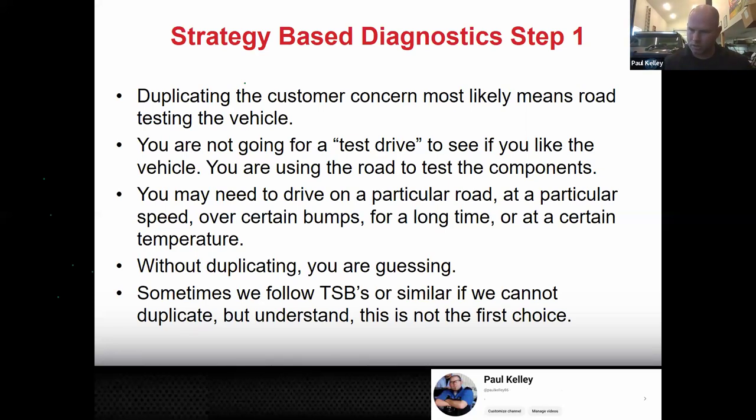On a Sunday, she'd go to Costco. It was full. She'd go down the aisle, no parking spots. She'd turn, go down this aisle, no parking spots, turn, go down this aisle. This car happened to have a loose wheel bearing. When she would turn, the rotor would flop like this because the wheel bearing was loose. And it would actually push the piston in a little.